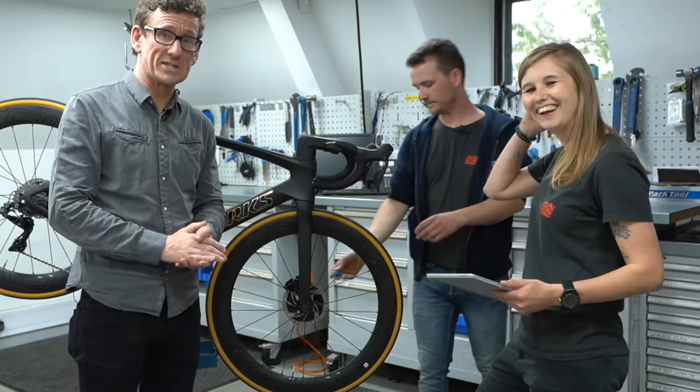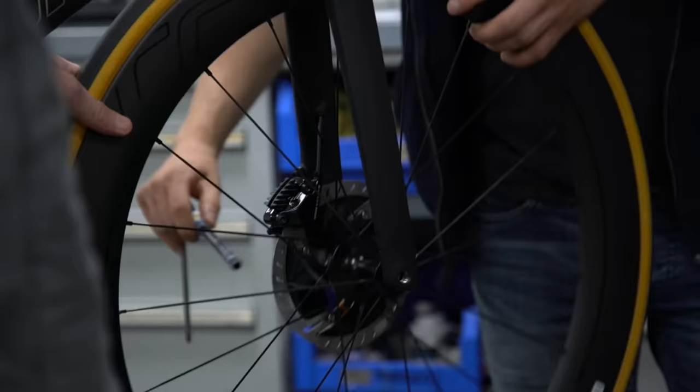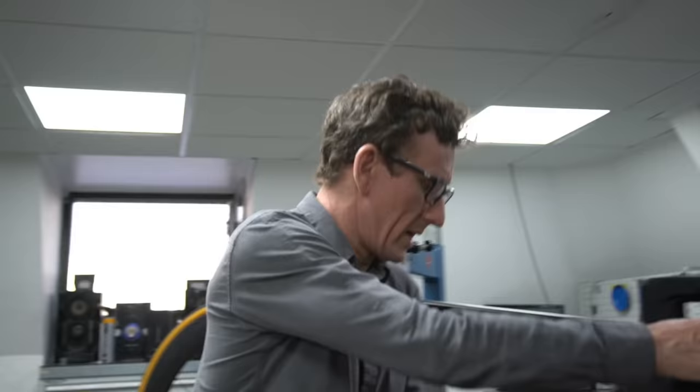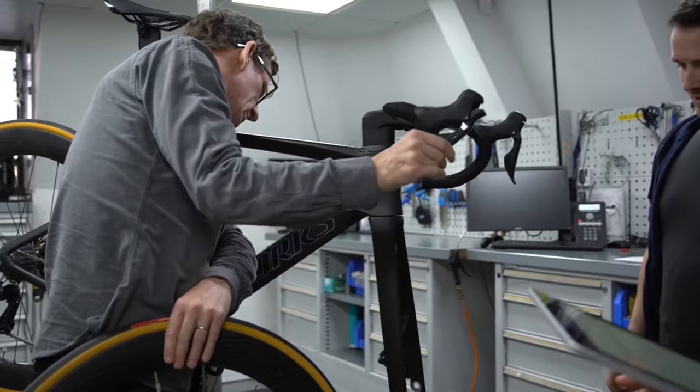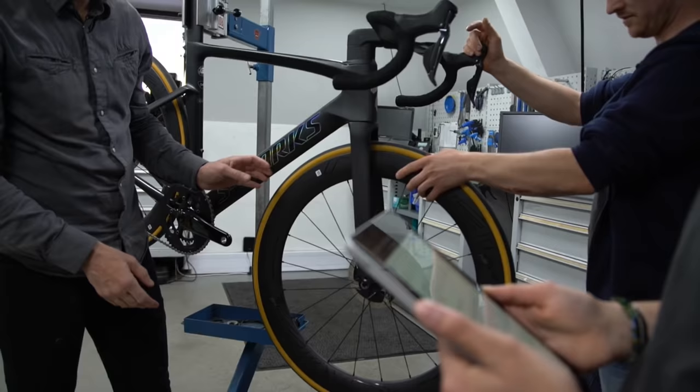This is live, actual bike mechanics in your living room. We'll drop the wheel out straight away. Do you want to pump the front brake there? Give it a good couple of squeezes — you can see it already starting to close up. You can probably feel it in the lever as well. If you pop that wheel back in you'll see how much it's rubbing. You probably won't even be able to get it back in again. No chance.